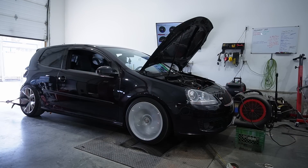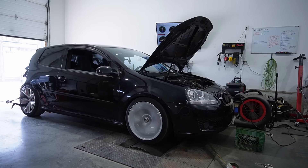We're ready for the first run. I already had to flash it once to get rid of the two-step, since that prevents us from running the car on the dyno — it just wants to sit on two-step the whole time. I haven't done anything else. We're just going to run it and see where the air-fuel is and where the boost sits. The first run came in at 324 — pretty close to where it was before. The last time it was here it did 337, so we're basically right on. I'll look everything over now and start making adjustments to dial in the water meth.